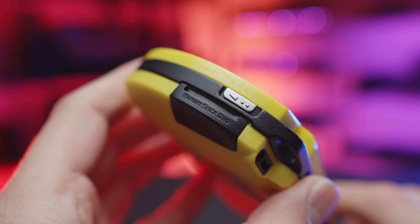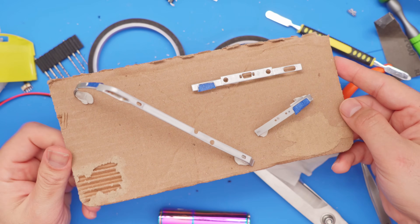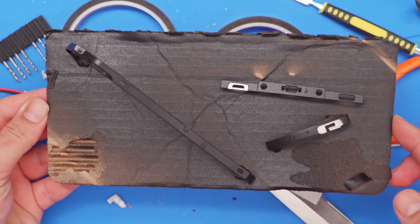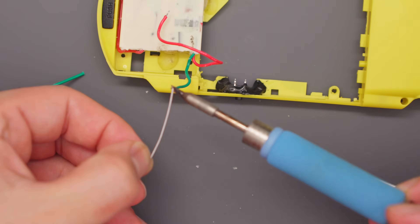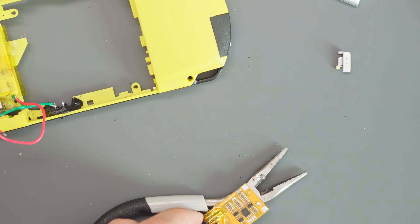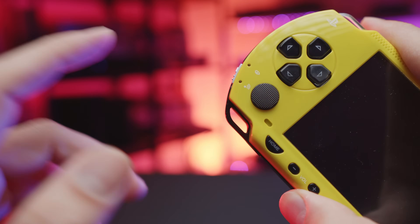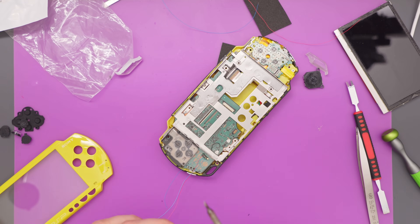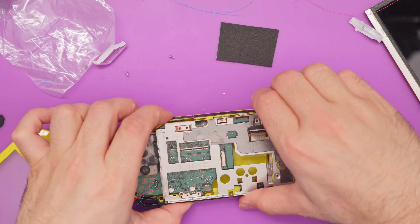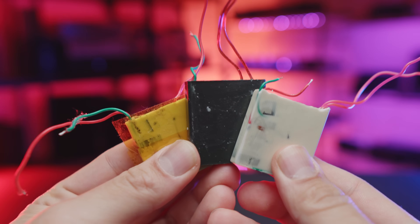You'll notice I left out the levers for fitment reasons — I'm still testing the best way to spray paint PSP parts. I think spray painting an original shell is the best shell you can get your hands on. We moved on to installing a safety power switch in the battery compartment, wired it all together, and hot-glued it into place. Then more fitment tests, adjusting the BMS contacts so they reach the ones on the motherboard, and finished wiring everything before closing it up. Then I dealt with the classic stick drift issues — typical with shell swaps — and used my go-to method of soldering wires directly between the motherboard and the analog stick. We closed everything back together, and I thought it was finally done. But I played around with it off-camera long enough to cook it — so at this point we had destroyed three of these units throughout the entire build.